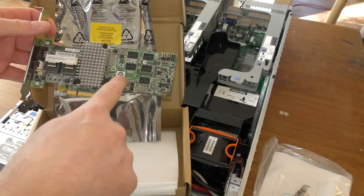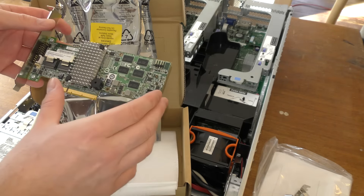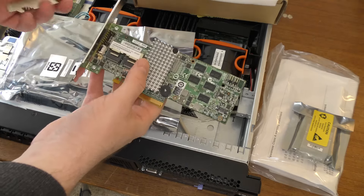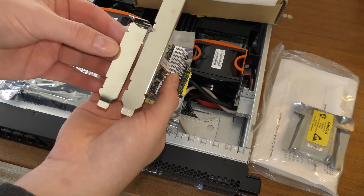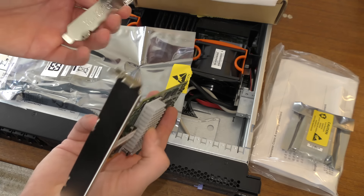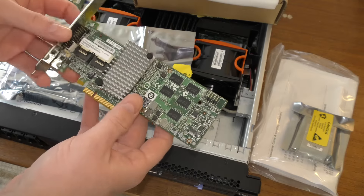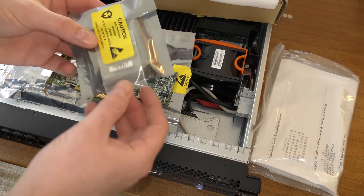This is the RAID controller, and over here the battery is mounted, which enables the controller to do more. This RAID controller can also be changed so it can go in a half-height PCIe port — the M3 and M2 don't have that — but if I were putting this in an M1, I'd have the option of using one of the two slots the X3650 Model 1 has, and for that I'd use this bracket. For the M3 we're installing it in right now, this is all good.